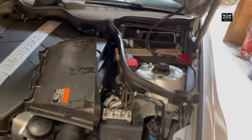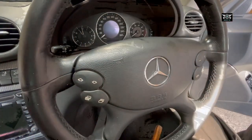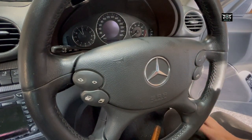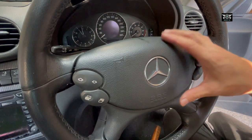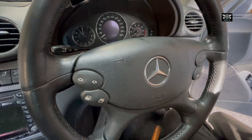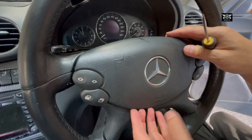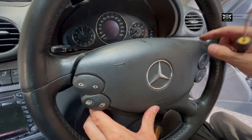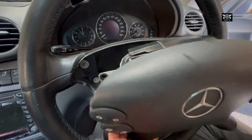I'm going to leave it for about 10 or 15 minutes, and then we can tackle the airbag. Even though I'm leaving the battery disconnected for 15 minutes or so, some people will say leave it out for three to four hours or even longer - so even a day. Obviously you do whatever you do here at your own risk, but perhaps the longer you leave it, the more sure you will be that there's no electricity left on the airbag to deploy.